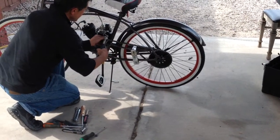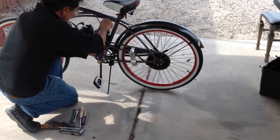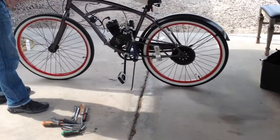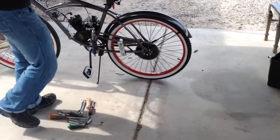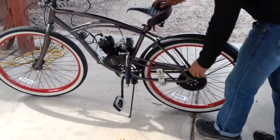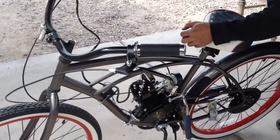I'm going to do the same thing — set my vice grip a few millimeters underneath the stop, go ahead and unscrew, release some of that tension, then retighten. Looking for disengagement when the wheel is turned. Let it out — looks like we have close to the position we want. Listen for the sound. And that's the proper setting you want. When the clutch is let out, the motor is engaged and you should be hearing that fa-fump, fa-fump sound.